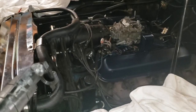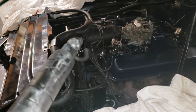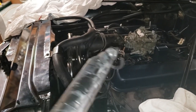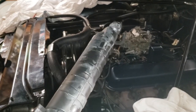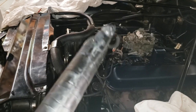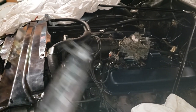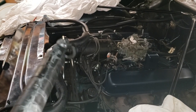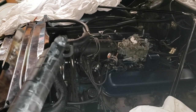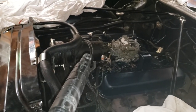We got our power steering pump all tightened up. Got those two belts tightened up. This has the double AC compressor. During all of this work I was doing, the compressor was tilted down that way, and I had the rope on it to keep it out of the way. In retrospect, I probably should have just removed it, because I noticed out of the clutch area, it was leaking the oil out of the compressor. This compressor is shot, so our next project, that thing.